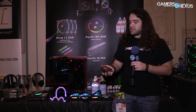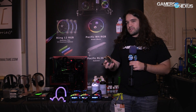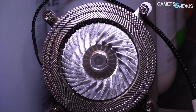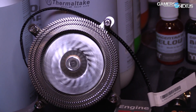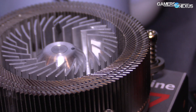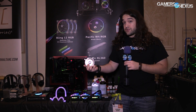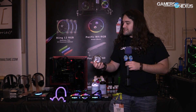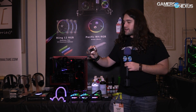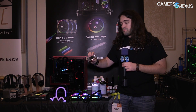Those CPUs have about a 65-watt TDP, so something like this would work for that. The difference from this versus normal coolers — as you'll notice in our b-roll — is that the unit does not use a traditional fan. It's actually got aluminum fins in the center and a kinetic bearing in the middle for the rotation. These aluminum fins work as a normal heat sink — they sink the heat — but as they spin they push the air out through an outer aluminum fin array, giving you additional surface area while cooling at the same time.